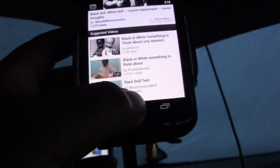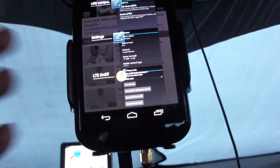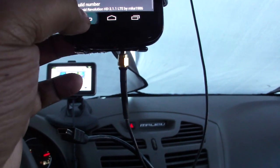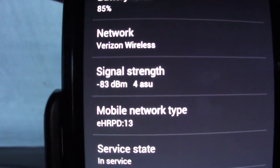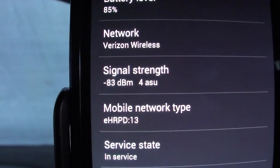It was 85 or 87 dBm before, so now let's see what we have on the 3G data connection. First I'm going to unplug this and turn the signal booster off. Now it's showing 73 dBm for ASU — I'm not sure what that means exactly. Now let's plug this back in. Everything is turned off. Now let's bring it back on — green means there's no issues.